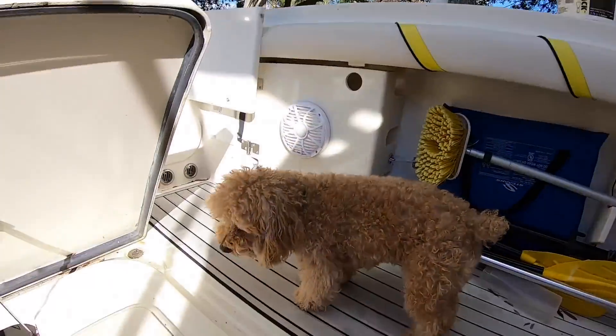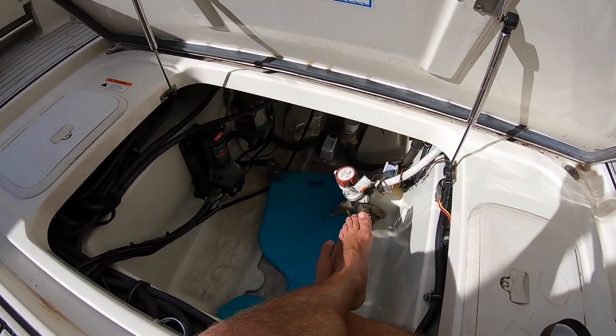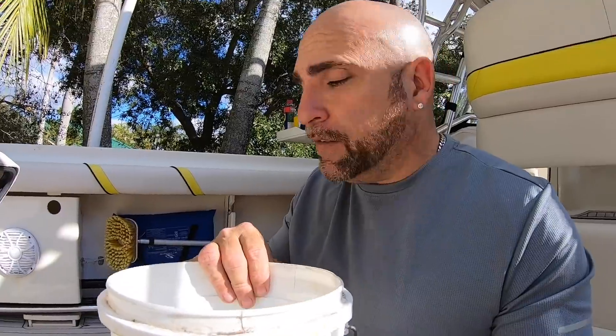So far I think it's been over a year. Once I'm in that hole it's hard to get out. What we need is a little bucket that I already have here, because the fuel filters are under pressure — maybe five to ten pounds of pressure from the fuel running through. Once I loosen them it's going to leak fuel, so I'm going to put the bucket under the fuel filter to catch the excess gas so it doesn't go in the bilge.